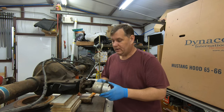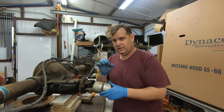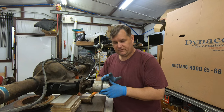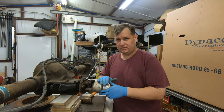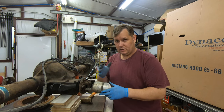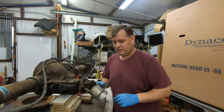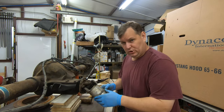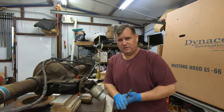This is an aluminum drive shaft - on certain Explorers, the ones that have the aluminum shaft, nice and shiny. For you guys up north it looks like battleship pipes. I believe it's '65-'66 - and don't quote me - I think maybe '67-'68 as well, where this stock aluminum drive shaft is almost exactly the same length as the stock drive shaft that was on those Mustangs. So this aluminum Explorer shaft will fit certain Mustangs with certain transmissions without any shortening; you just have to worry about u-joint sizes. I'll grab another full aluminum drive shaft to use or shorten for mine.